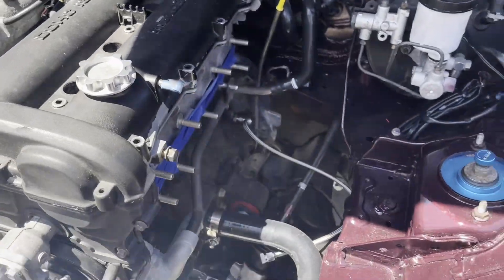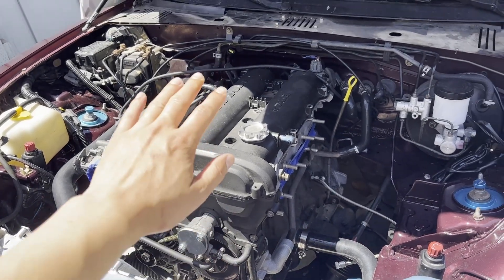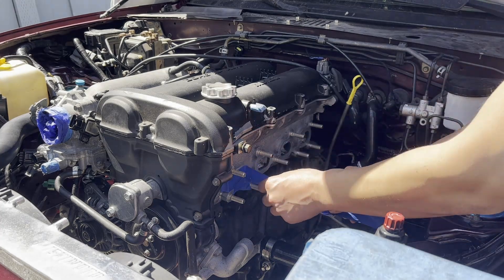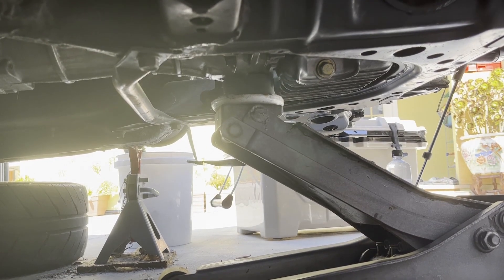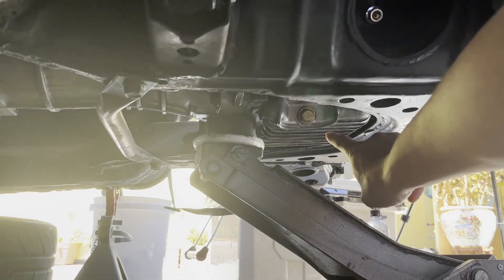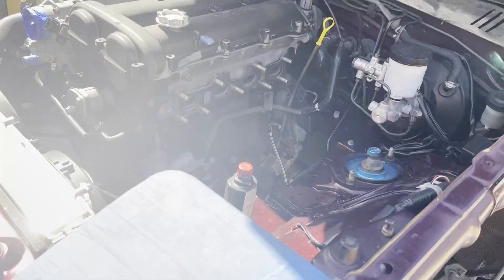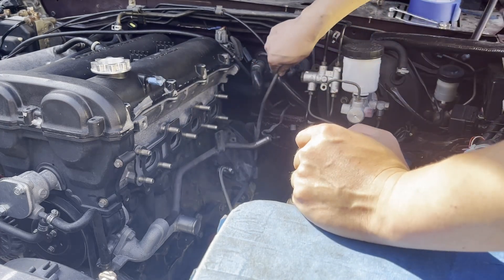Now that the oil feed is in, one last thing before we put the turbo on the motor is we have to loosen the motor mounts so we can lift up the engine just a little bit to squeeze the turbo into the space. So I've got the motor mounts loose. Next, let's go ahead and get on the exhaust manifold gasket. Here's where you want to jack up the engine from — I jacked it up right where the transmission meets the back of the engine. Don't jack it up on the oil pan or else you're probably going to have a bad time. Now that the engine's jacked up, get this big thing up in there. To make some more room, we're going to take the dipstick out — there's a 10mm holding it on right here and then it just pops right out.